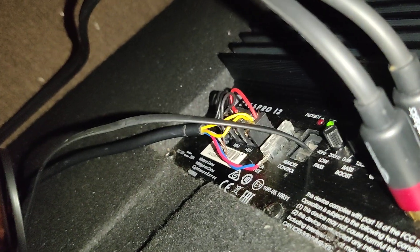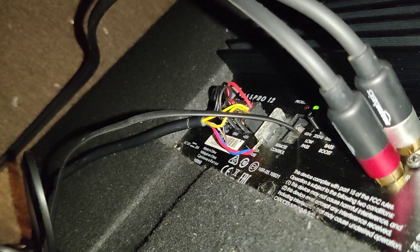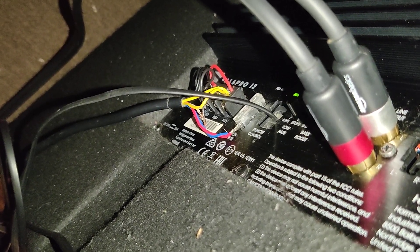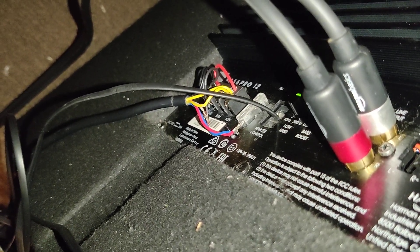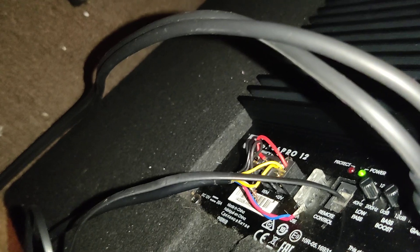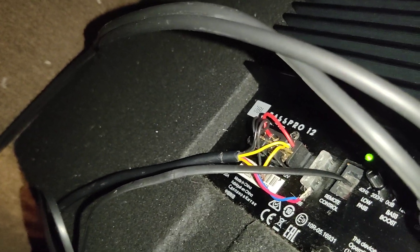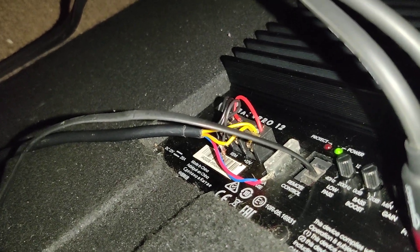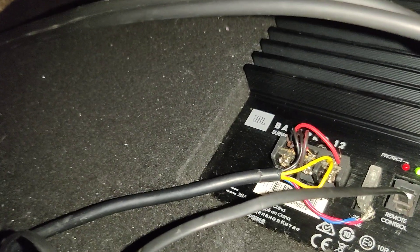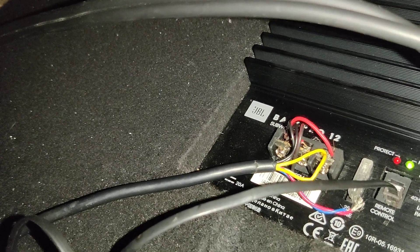Coming to the back here, you can see the red and blue cable. I don't have electrical tape on this right now, but it works. You strip the red and blue cable apart — the blue cable is the remote wire and the red cable is one of your power wires. You'll need an additional piece of wire to run from the remote turn-on to the power. The two yellow cables coming from around here, I wrap those together and put them into the 12-volt. Then you have the remote wire for remote turn-on, and the black wires — it has two black wires and a gray wire.